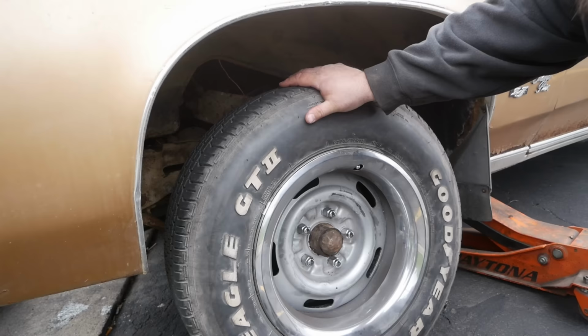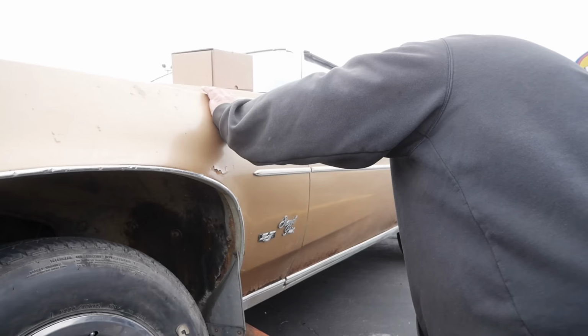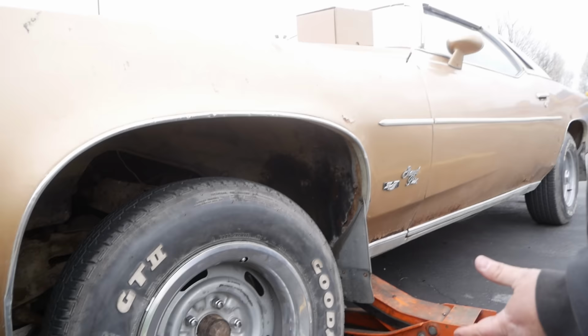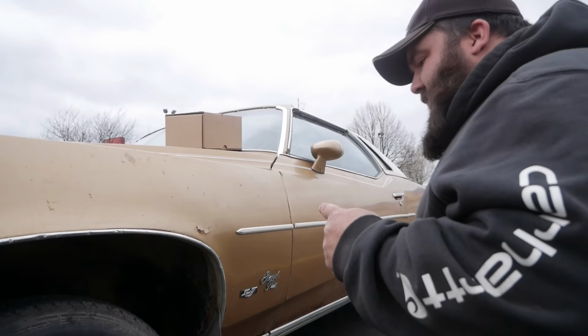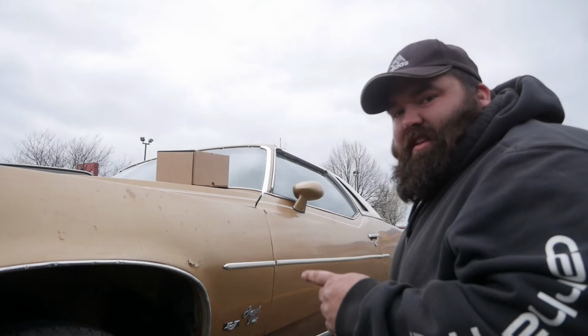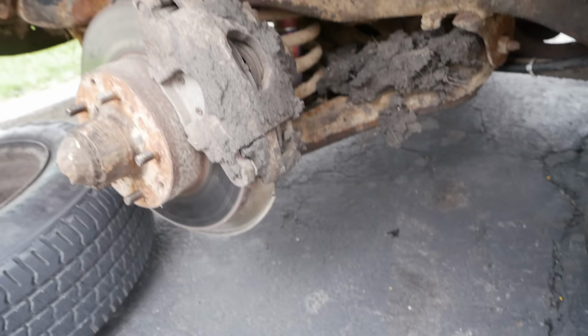Before this gets bad, it's probably the rubber hose, right? But we think we could alleviate this by putting a new caliper on it. If it is the caliper that was packed with mud, we're right. Giving it our best chance to save the pad. Right, because I did not bring brake pads. And since we have to stop 15 times for fuel, we'll know quickly if it's working. The next fuel stop. Right. We got plenty of pad left right now.